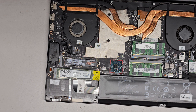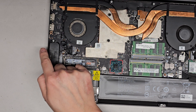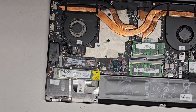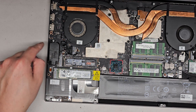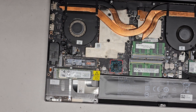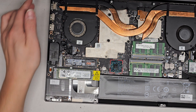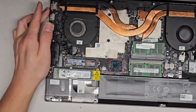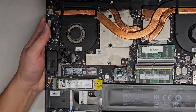I tested it in line without unplugging the battery. Anyway, the positive wire is going out towards this side, and the negative wire is going out towards the CPU, GPU, heat sink assembly. So if you get a new battery, the red wire will be towards this side and the black wire will be towards that side, if it's color coded. If it's not color coded, you'll want to check the polarity just in case, because sometimes they switch these pins around and you can fry your computer.